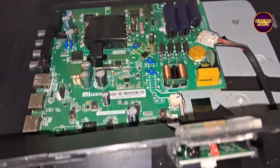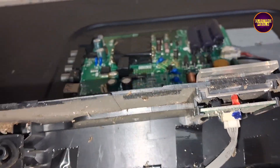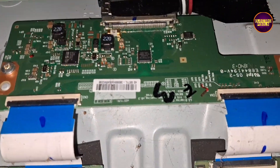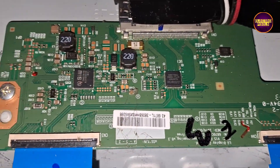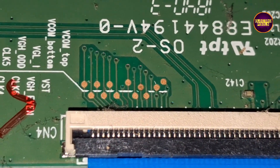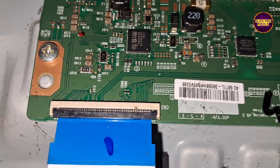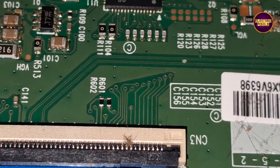Let's start the repair. As discussed earlier, these types of display complaints are mainly due to internal shorting in gate signals inside the glass panel. The shorting may be either from the right side or left side of the panel. If both sides are shorted it's difficult to repair, but if only one side is shorted we can repair it using a temporary fixing method by blocking gate signals from the shorted side.